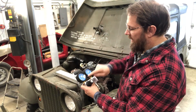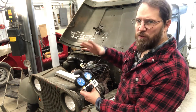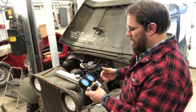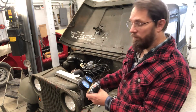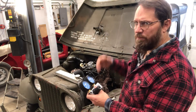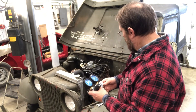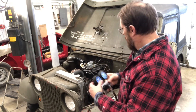If you use a lower pressure you just have to do the math. What pressure you use will depend on the engine you're working with, because once you put pressure in there it will try to force the cylinder down. So when you do it you should always have it in gear with the parking brake on so that it doesn't walk forward on you. Let's go ahead and get started.